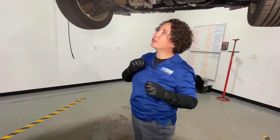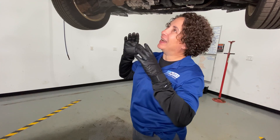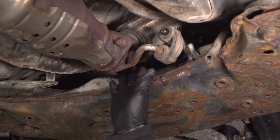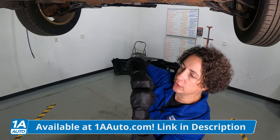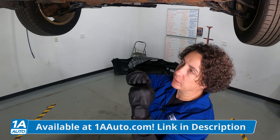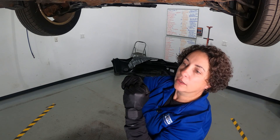I'm going to show you where I think the problem is — I haven't quite diagnosed it yet because I want to do it live with you using home products. My experience tells me it's probably up here in this mesh area. Not every car has a flex pipe or mesh area; it's kind of like when you put the car in gear, the engine moves a little with the mounts, giving the exhaust space to flex instead of hard solid metal that would rip the gaskets out.